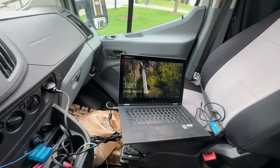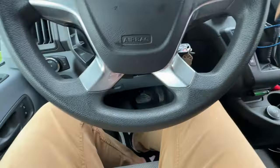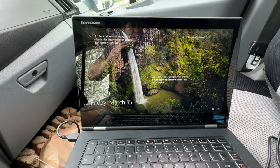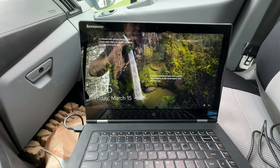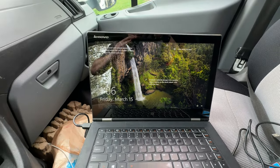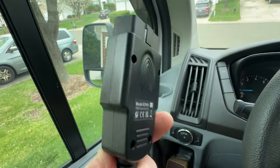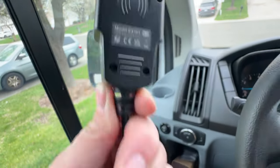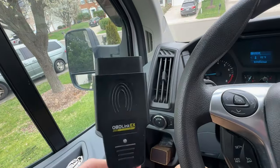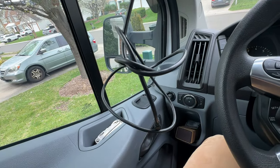For this section you're gonna need a laptop, you're gonna need FORScan software, and you're gonna need an OBD link. I'm going to record the screen with the phone. Here's the OBD link I'm using — this is the OBD link EX, it's one of the ones recommended by FORScan. I'm gonna go plug this into my OBD port, plug the USB into the laptop, and start up FORScan.